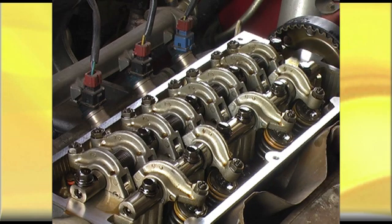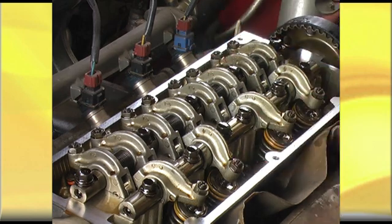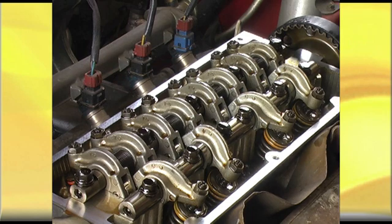This worked out pretty well for us — I didn't stage it like this. If you're doing it, you may find that this one will start to come up and then the inlets will open, so you'd set number three. But for ease and simplicity, start at number one or number four and then work through your firing order that way. If you've never done this before, that'll probably be the best way to start — start at number one cylinder and work your way through.